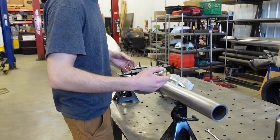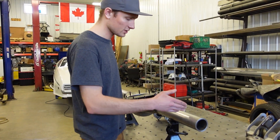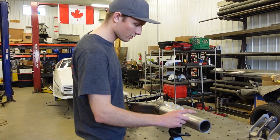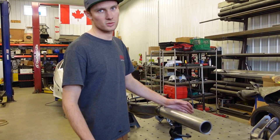We're going to be cutting out about five inches of axle tube. Going forward, just use a tube wrap-around for marking so you get a nice square line around the whole thing. When we go to cut these ends off, I'm just going to follow my blade on the outside of the line, and the tube will come out very close to square.